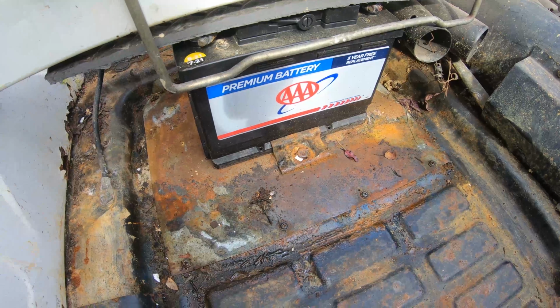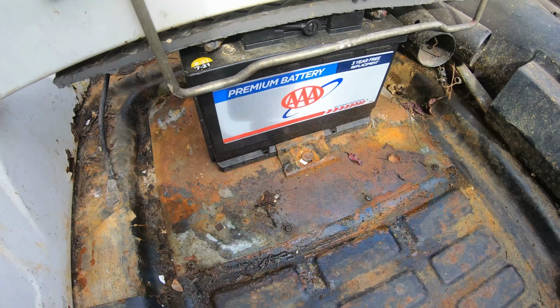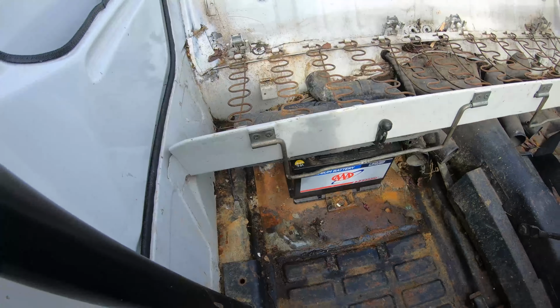And then also up in the front, we got the fuel tank out, fuel systems out. And the only thing left to unhook up here is the brakes to the body. And the plan on this, the friend that's helping me do all the body work, he wants to get started on it. So rather than waste some time trying to get the body ready, we're gonna pull the body off the pan, and I'm gonna send him the pan for now, because you can see in the pan right down in here, it's been patched previously, and it's all rusted through.